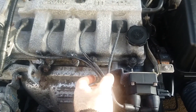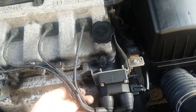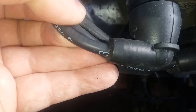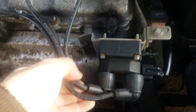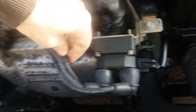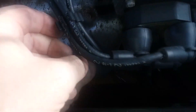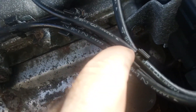Other common things I see on these cars and any other car: when you have spark plug wires that come close to or touch each other, it's best to use clips to hold them apart. The more they touch, the more they'll burn together. If you see this carbon tracking right here — these wires are actually melting together. Since we're likely to drive this car to get parts, I might put some electrical tape around that just to help us get there.